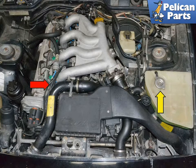Move to the top of the engine and open the cap on the coolant reservoir to help break the vacuum seal and drain the fluid. You are going to need access to the vent plug on the top of the motor to vent the system while refilling it. You can vent the system without removing the turbo pipe, but it is going to get messy. I prefer removing the pipe.